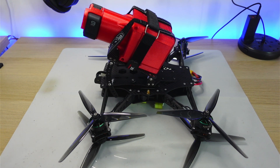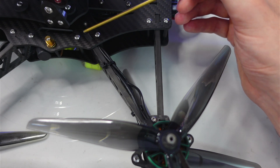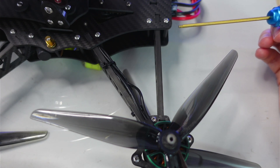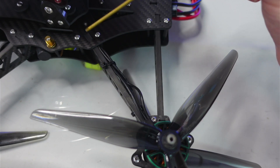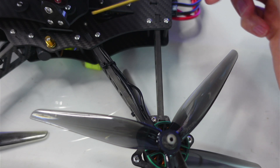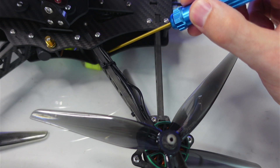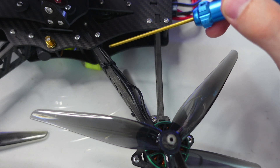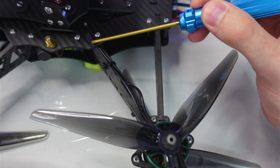Let me take you through the key design features of the Cine 80 on the bench. Let's start by talking about the arm design, which is quite different from other frames that I've designed in the past. The Cine 80 uses a vertical truss arm structure to achieve its vibration and resonance performance. You can see we have two vertical pieces of carbon fibre, and these pieces lock into the top plate and the bottom plate with these cutouts. There are two long screws that pass all the way through the top and bottom plate, screwing into press nuts, which compress the arm really tightly and create an enormous amount of friction, locking the arm in place really securely.